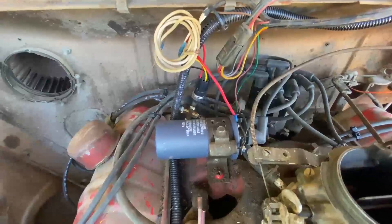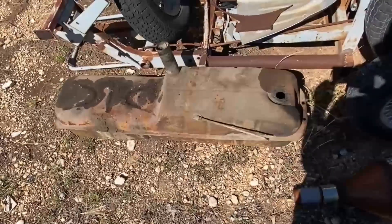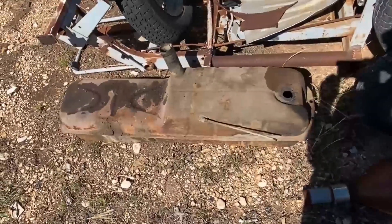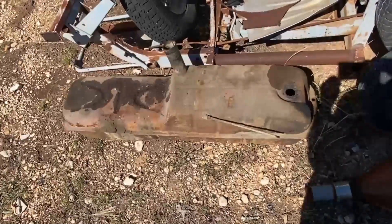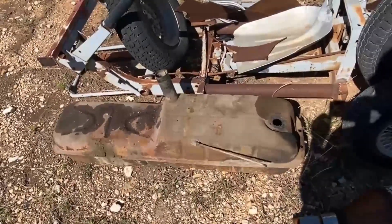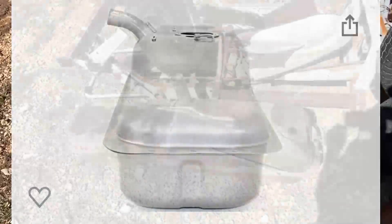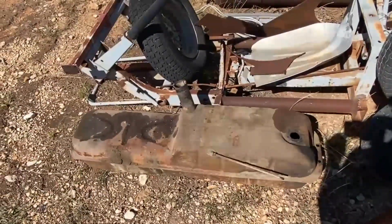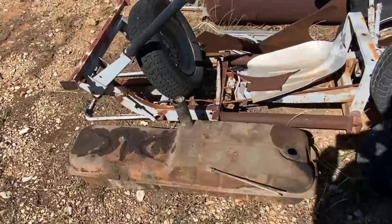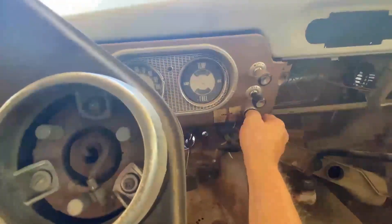Here's the fuel tank I dropped out from under the old Studebaker. It's in sad shape — it's full of old dried-up fuel, has a rust hole at one end and another leak on the other. I did some looking on the internet and, believe it or not, a Mazda pickup around a '93 model extended cab tank is just one gallon short of being the same size. I have one of those Mazda tanks and I've ordered it, so it'll be here later this month.